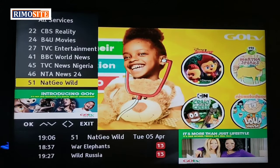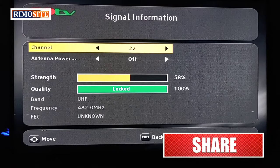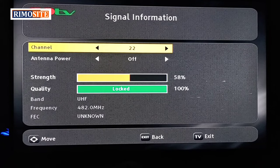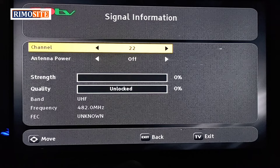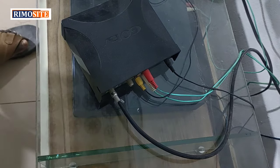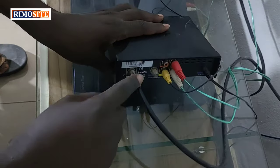In this video I'll be explaining how to do that bit by bit, so follow me carefully — something you can do all by yourself. First, pick up your remote and go to the signal information. You will see the bar for the strength is dancing between 50% and 60%, not stable, and at times it goes off. The quality bar is 100% constant, so if you've tried turning the antenna in different directions and it's still not working, then it's your cable.